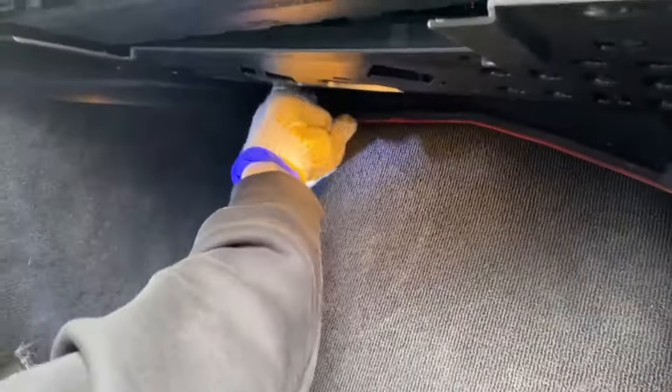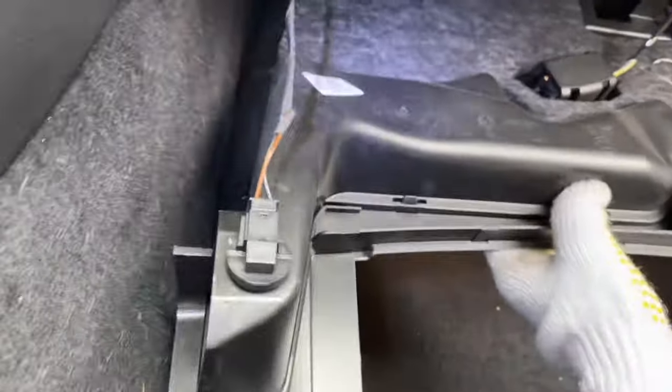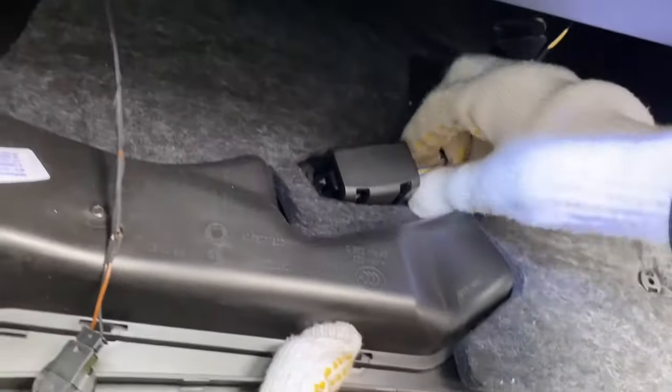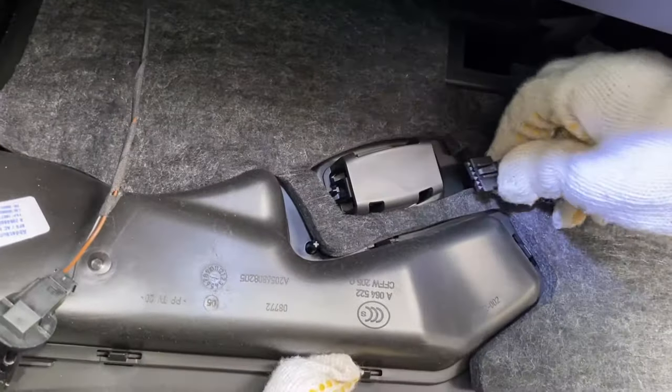To better remove the cover, take the floor mat down. When you take the screws off, unclip the cover to pull it down from the glove box. After taking the panel down, you'll see two wires. Twist the sensor this way and it'll come right down. Then unclip this light and pull it out.